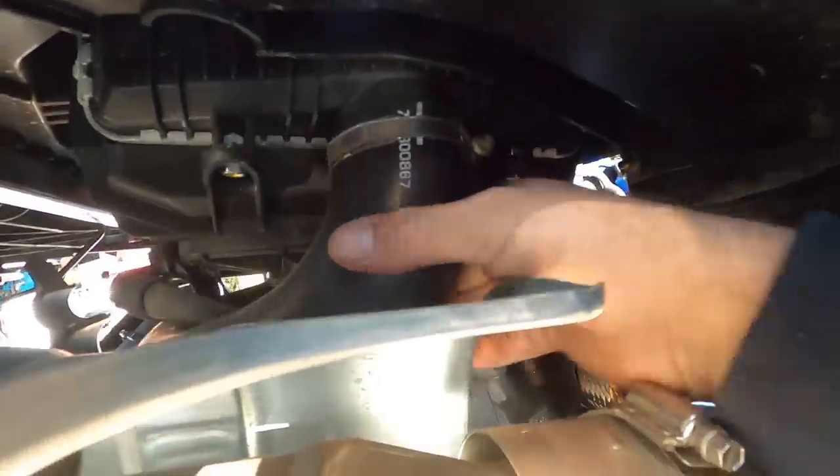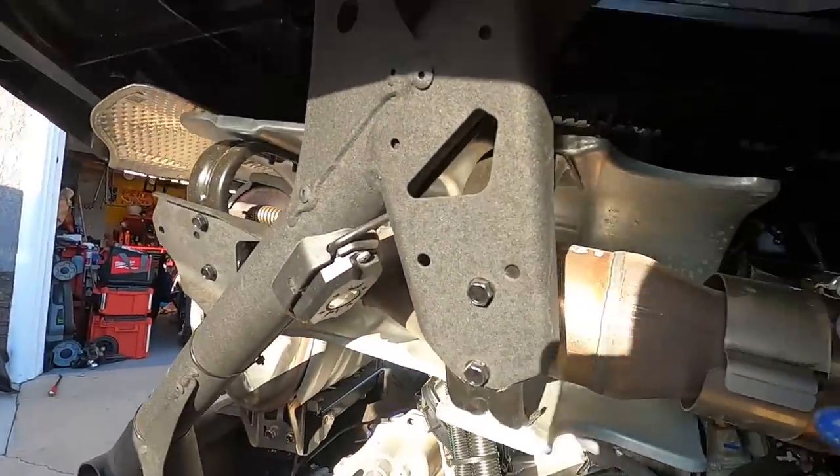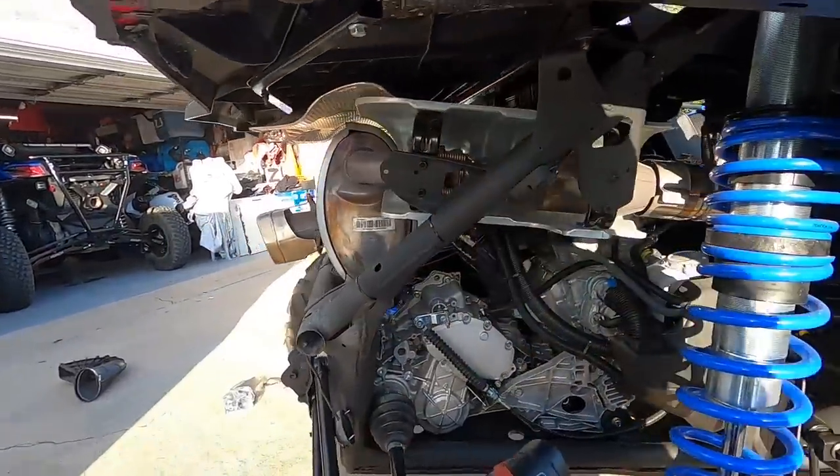And that's all it is to it — just take this guy off. You want to show them how to do it without taking off the exhaust? Now, we could take off the exhaust because we are going to do a shocker install on this too, but I figured we'd do a separate video for each because not everyone is buying multiple items at once. You're most likely just going to buy some charge tubes and a blow-off valve first, and then maybe down the road you'll get an exhaust. So step by step on this one, we're going to just do the charge tubes. It probably would be easier if the exhaust was out of the way. So that tube's out of the way. Now we can pretty much take it out of the car, and then we'll focus on the plumbing for the blow-off valve.